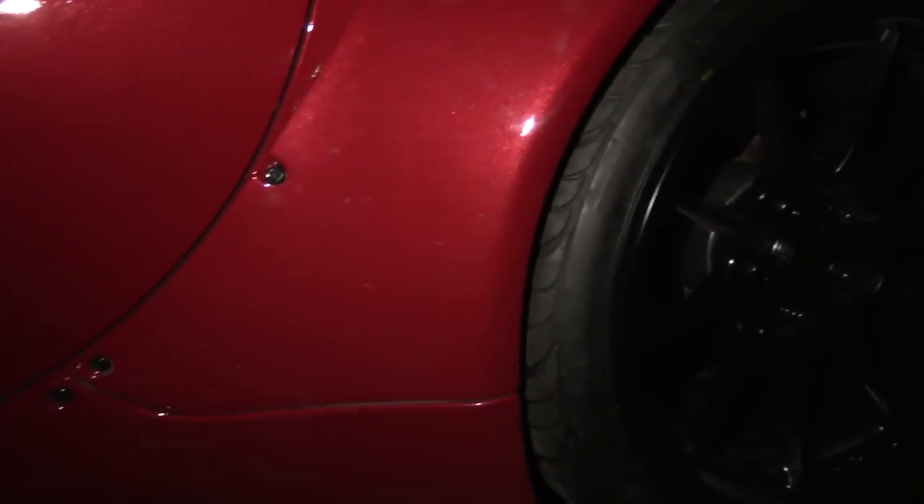Sorry it's so dark, but the side skirts are on — and they're really on there because I spun out one of the rib nuts, so it really can't come back off quickly. That's a good lesson: instead of using crimp-down steel rib nuts like I was using, use rubber well nuts like what we used on the WRX. Those are a lot better. Just take the time, order them in — it'll be worth it. Let's drive this beast home.